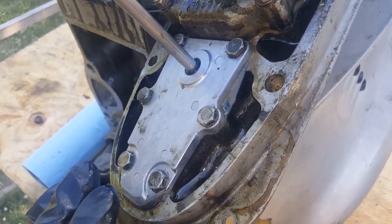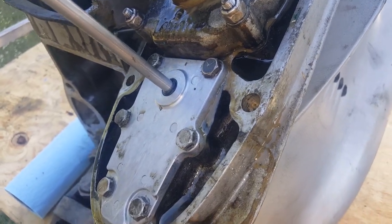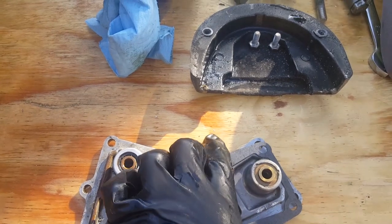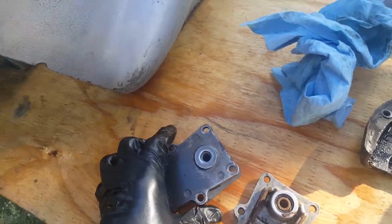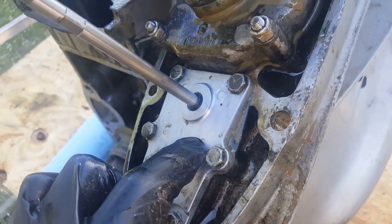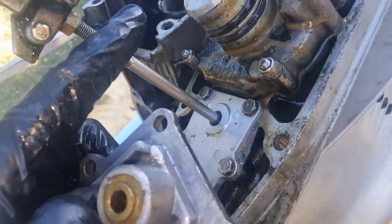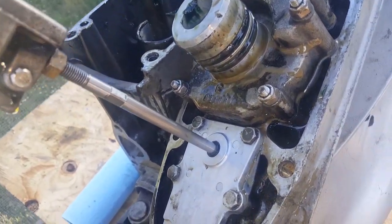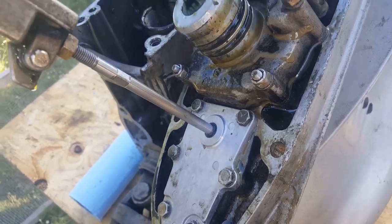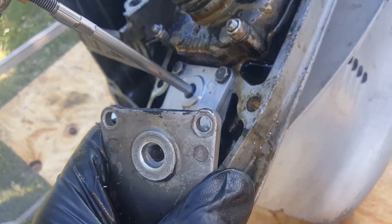The question is, if your cover seal is in good shape and condition, do you really want to break the seal and have to get another gasket? You don't have to, and I'm going to show you an easy way not to do that. I've got some shift covers here — these are genuine OMC style ones. What I'm going to do is take a few measurements with the gasket so when you're taking your measurement from the cover, you can use this to determine what yours is going to be. Some people may ask about that difference — this is almost a quarter of an inch. That will throw off the overall height and affect everything from your ESA system to the way it engages. It may engage more in forward versus reverse, so this has to be configured right.